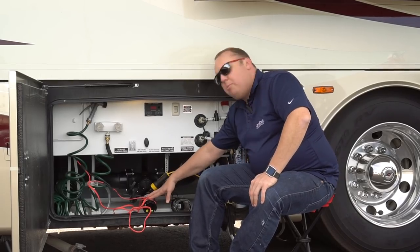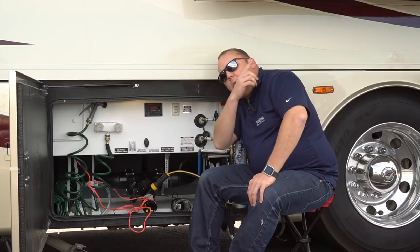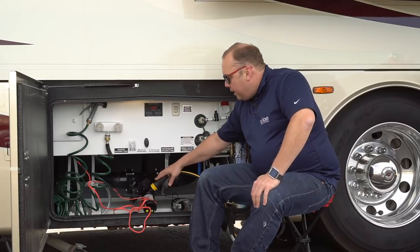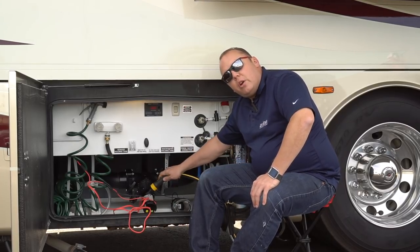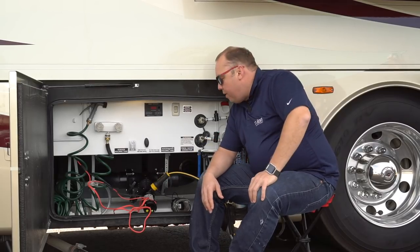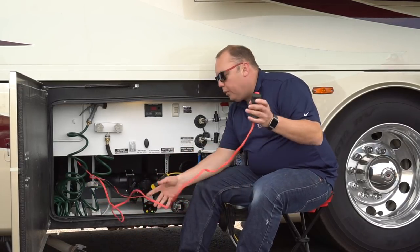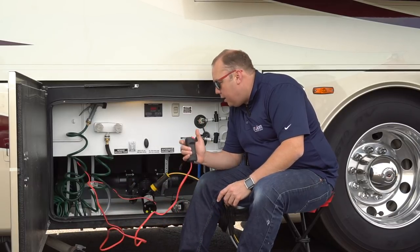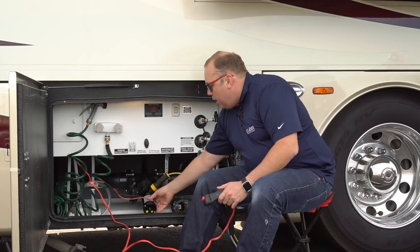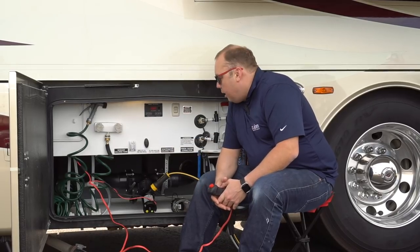The reason why all this is here is that about a hundred feet behind you is a dump station located in their campground on-premise. Now this is a portable macerating system. We've already done a video on this — I'll put a link here — but essentially what this does is allows us to dump our tanks through a standard garden hose. Because we have a hundred-foot garden hose, we can use this system to dump our tanks way behind you without having to move our coach. One wire is a trigger which turns on and off the macerating pump, and the other wire goes up to the 12-volt power with a quick release.